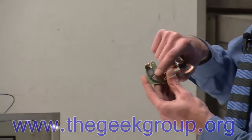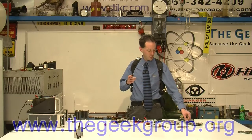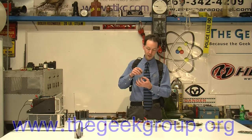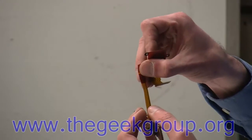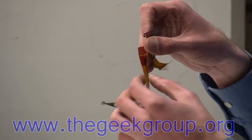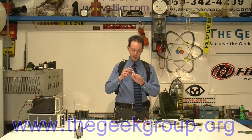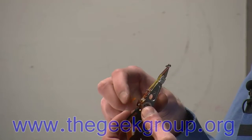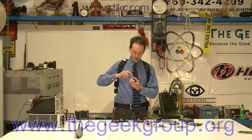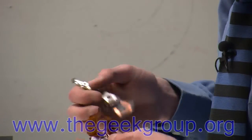Usually there are two or four magnets. They'll look like this — in a little cage on a really good bearing. You want to keep the magnets in there because it won't work without them, and you want to keep the armature in there. So leave all this stuff inside. Now, connected to the armature will be a little flat cable thing like this. If you look at it closely you'll see it's translucent — a brown translucent thing — and you'll see lines inside, and those lines are actually wires. Follow it all the way down to the head. On the head side, all the wires inside will connect to solder points, except for two. Those two wires loop back and connect to the voice coil. You can see the other end right here at the solder points, then follow them all the way up the cable and around.